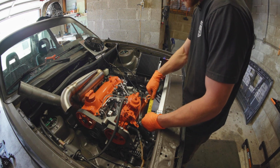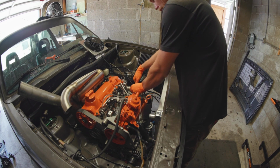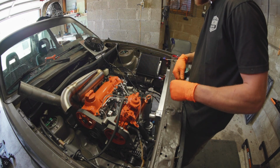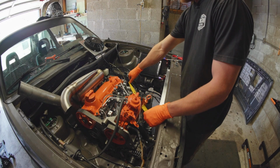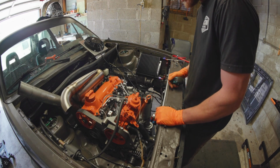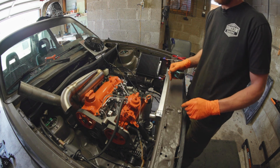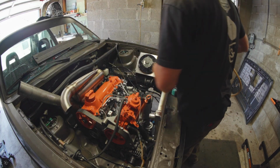And then it also needs to be a 1.25 inch ID hose. That's what the VW hoses are, as far as I can tell. It's like 1.25. So the hose will go approximately like that. I can go to the auto parts store and see if I can find that just somewhere on their shelf, and go to the hardware store and get that hardware, and then come back and see if we can assemble a useful cooling system.